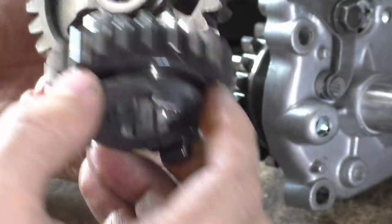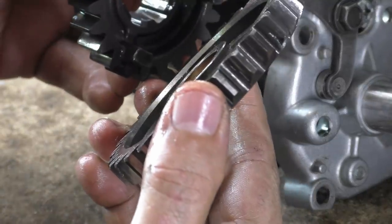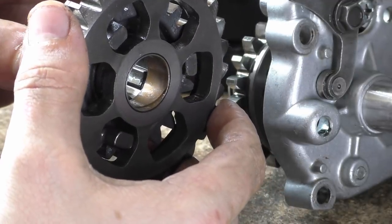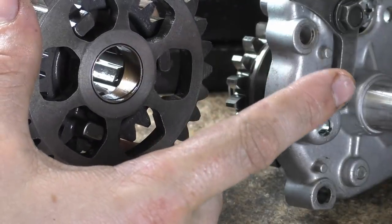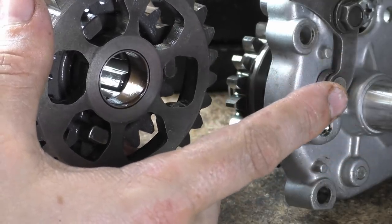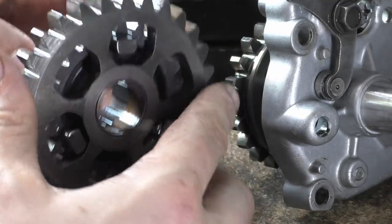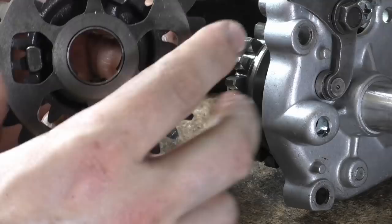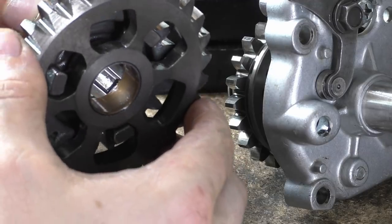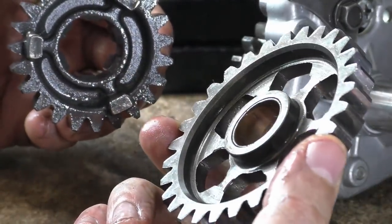So basically someone's, I'm trying to work out which way it'd be. That's the shaft, it goes in that way. Most of the damage is on that side, so this would be that way, counterclockwise, clockwise. This shaft would be spinning the same way as your rear wheel. So your rear wheel in this orientation is turning, looking from that side, clockwise. So clockwise would mean this is turning and that's clapping that way. So yeah, most of it is actually getting out of first gear into second.